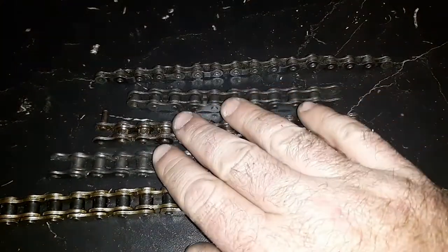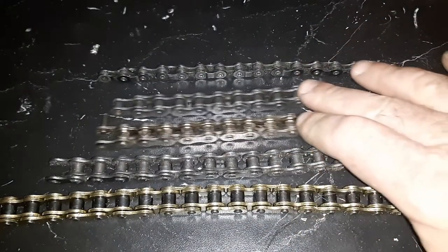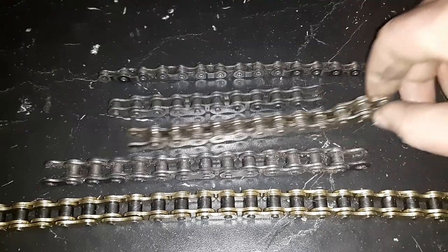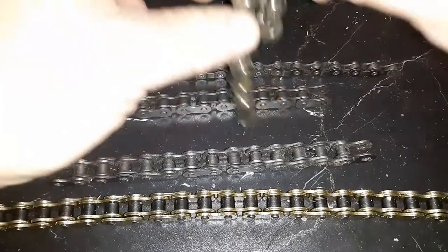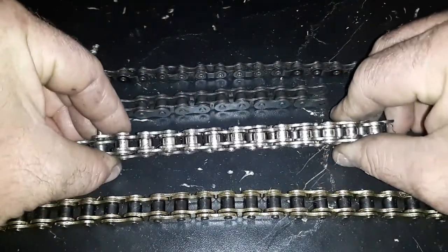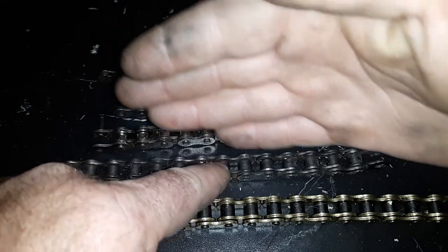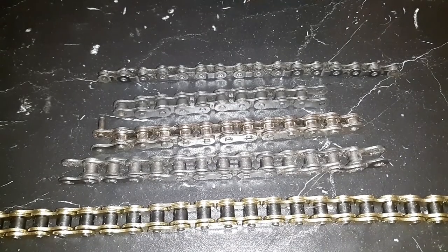But yeah, I hope that helps some people. This is a standard bicycle chain. These are the standard chains you'll see on a motorized bicycle, usually on a motorcycle right here. One thing to note too, if you try and use a 420, and a lot of people have on motorized bicycles, some cases will let you because they're pretty close. But sometimes this side, going in, like say your sprockets here, where your case, it'll chew into the case. So just be aware of that.